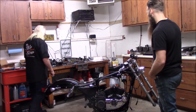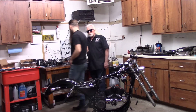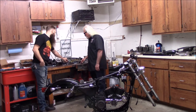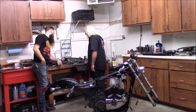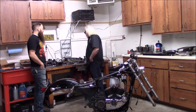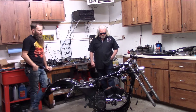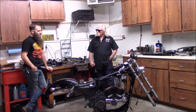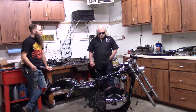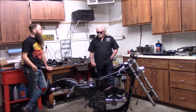I see you got your heads over here — are these the rocker arms you're going to be putting in? These are the stock ones for now, which I'm going to try to run right away, but I'm hoping to buy a higher ratio later to get more power out of it. And a clutch — what are you going to do? Right now it's got a Barnett clutch and it's probably not going to hold up, so we'll see how she does this year.